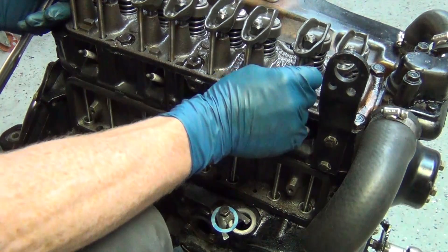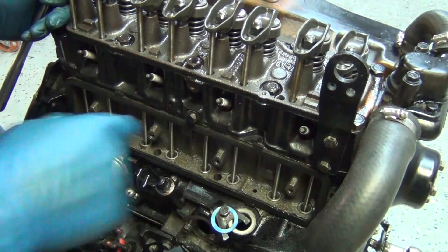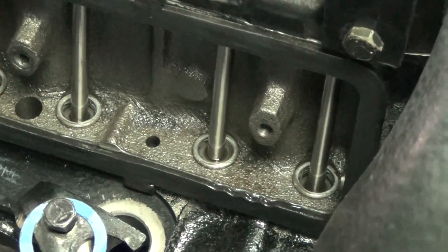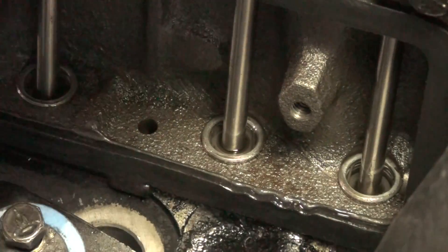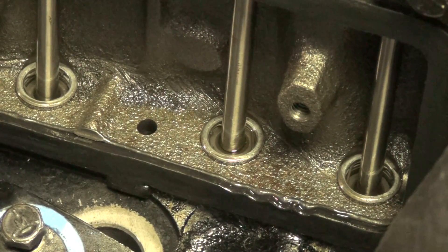So now these should be able to be spun. This one's about right, this one's not. This is why these need to be done — if you have no play, you'll have no compression; they'll be pushing on the valve. What I want to draw your attention to is this one is way down in there. If I take a screwdriver and poke in, you can see it's deep — this one is all the way compressed down. And this one isn't compressed at all, so this one would clatter, and this one risks being too tight and not allowing the valve to close all the way.